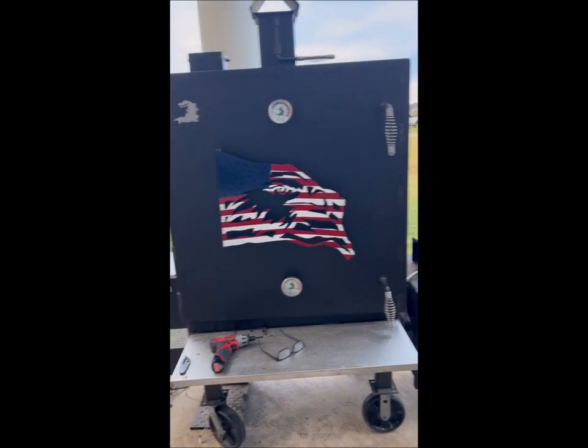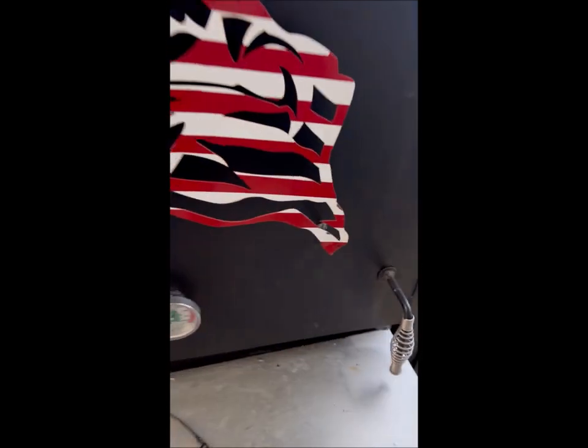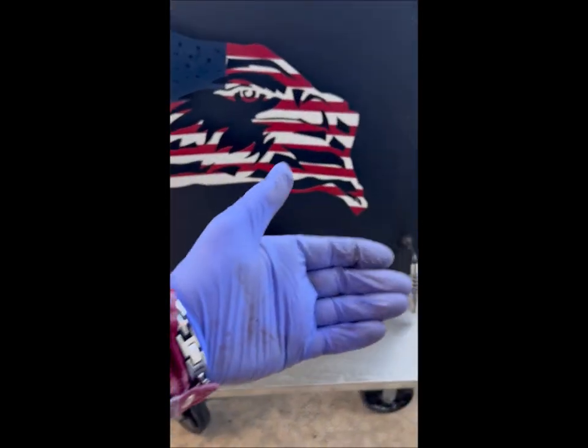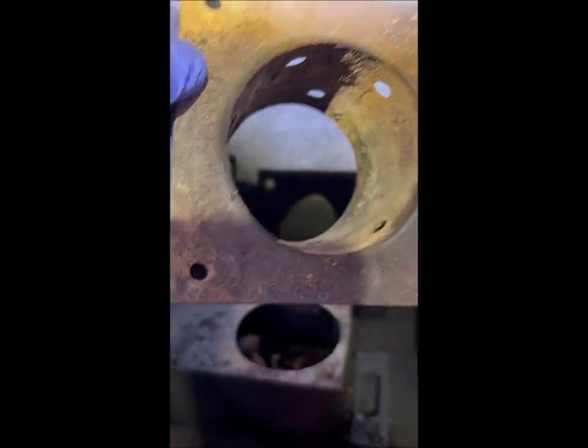All right, so here is my Meatsinger — the Meatsinger 36 Hybrid you may have seen on my cooking videos. I've got gloves on and a headlamp so I can see what I'm doing in here because it's dark. Inside here I removed the fire pot — that's your stainless steel fire pot. It is literally four screws, one on each corner. You take those screws out and it just lifts out. You may have to twist it a little because the hot rod is still attached to it.